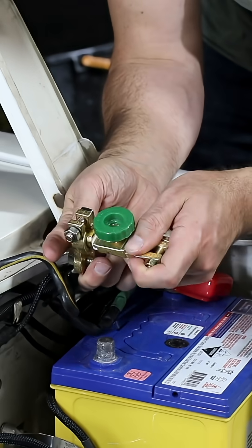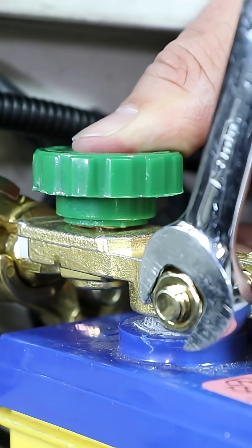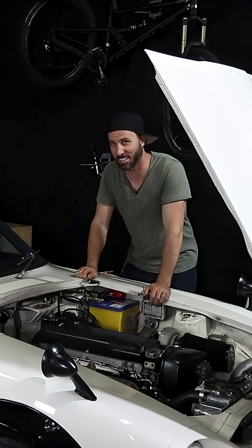It now completes the circuit — that is basically how you do it. It's threaded in that side; you just put that side on the terminal and put your original negative strap on this side. You can mount it any which way that you desire. Insert the isolator into the factory clamp, choose the right angle, then tighten it up. Once that's done, reinstall it onto the battery.